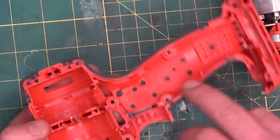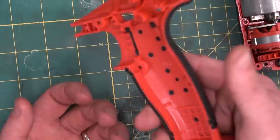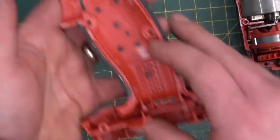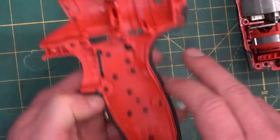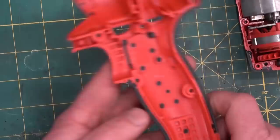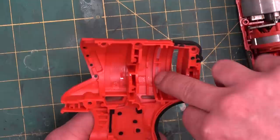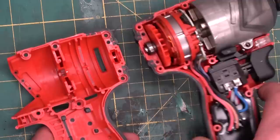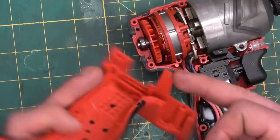Looks like they're blending it — possibly mitigation for attack by acids and corrosives. Looking at the mold now: of course this would be in a rotary mold — it would shoot this plastic and then move to another mold to shoot this over-molding. And the ejection pins are waffled — I wonder now if that's not to keep it in place on the pins so that it can move to the next station. Not entirely sure. There are some silicone bumpers stuck right in there to minimize vibration from the high-speed rotation of the brushless motor.